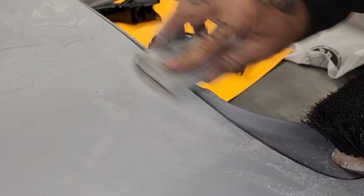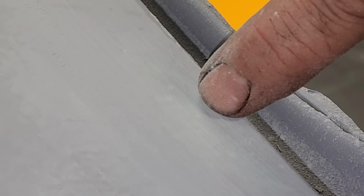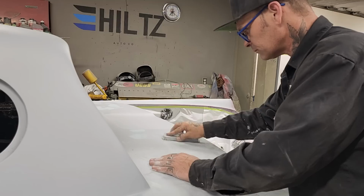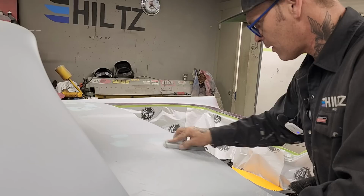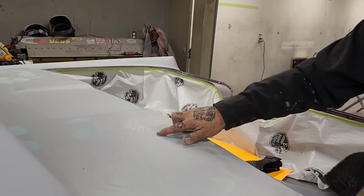You can see my pinhole? Pinhole there. Pinhole there. Pinhole there. Just cover it off. Leave it like that. Nothing to it. There's a big difference if you sand two-part putty, and to do all that, and then just do what I'm doing. Big difference. Pinhole. Taking that off really quick.